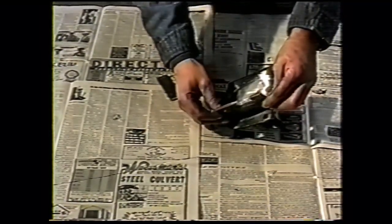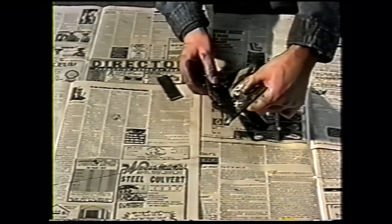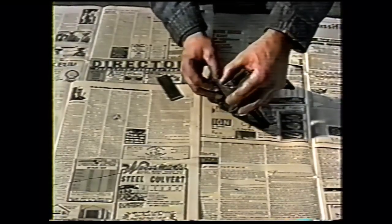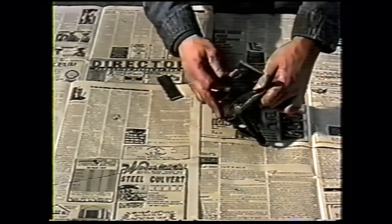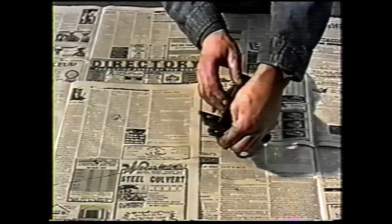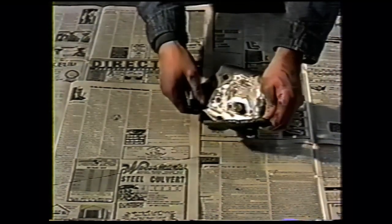We recommend that you tip this plate 5 degrees off of perpendicular. That will tilt the shifter a little bit more towards the driver, a little bit easier to grab a hold of, center it in the hole properly. There's dimensions in the written instructions of the angle to put this. Basically, you're going to weld that to that. Weld this stiffener plate to the original plate and transmission adapter plate, making sure that you don't fill in these holes because that cam has to go back into those two holes.